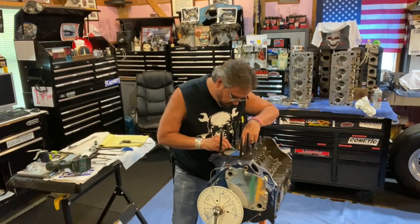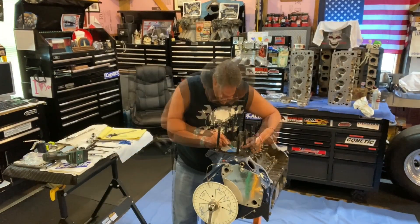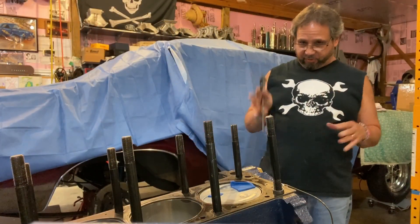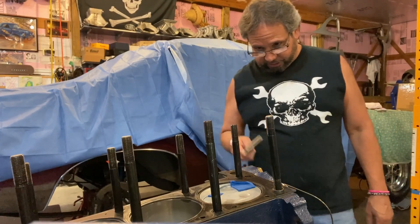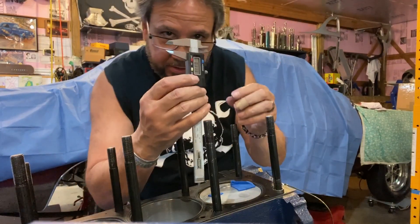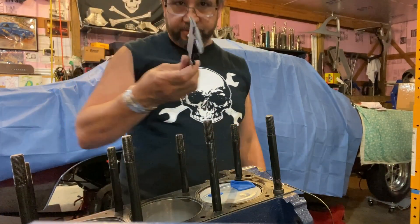Let's cut it with this razor blade. We can cut right through here and look at the closest area for the exhaust. The intake valve is going to take a little more care because I don't want to wreck it. Let's measure this — I'll get out of the camera for a minute. It barely even touched the clay on the exhaust. Calipers on, zeroed. I'll turn it this way so you can see it better. One hundred and six thousandths right there.